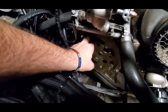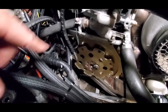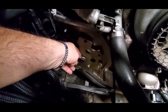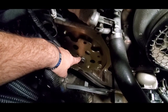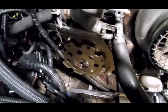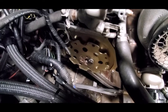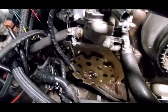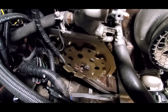The Kegley kit also comes with a flex plate, which is nice — it's thicker and it's not going to be real flimsy, and it has the surface for the eight pads. I also got some Nord-lock washers; mine are a little bigger in diameter than the recommended size, but they're not causing any problems. I use a lot of red Loctite to help keep the bolts from backing out, and I believe those are stock flywheel bolts.